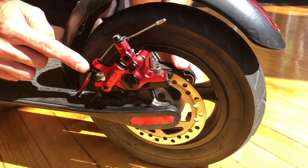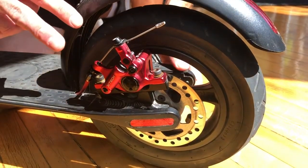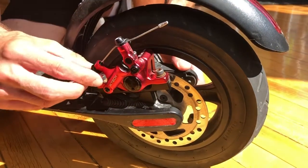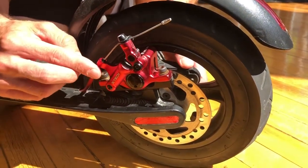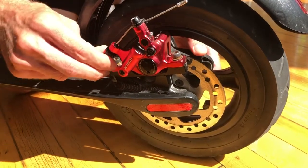The fastest way to adjust is using the spin nut here. Since you have hydraulic brakes on your scooter, both pads are adjusted when you adjust just this one spin nut. You loosen the locking nut here and then you can turn clockwise to tighten and counter clockwise to loosen.